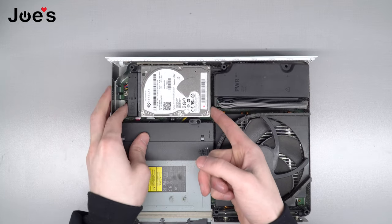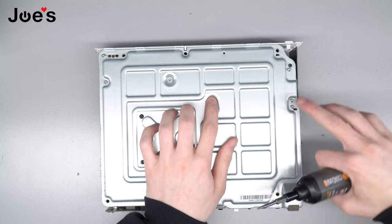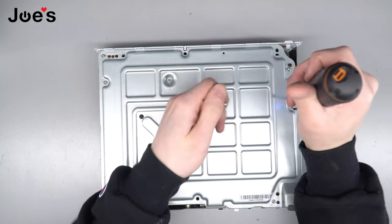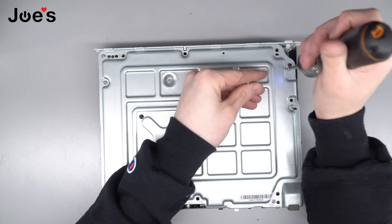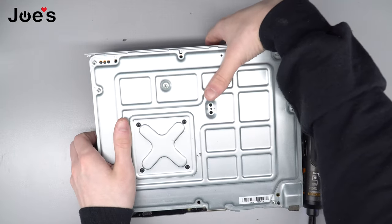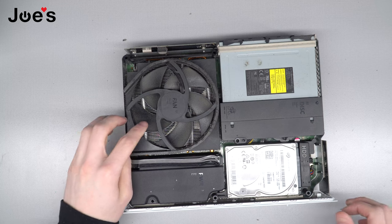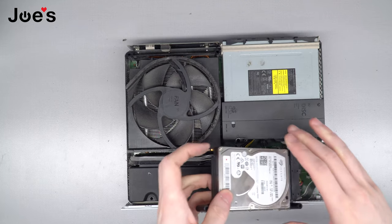It's on this little caddy thing. You'll be like, how come you can't get it out? You've got screws here on the backside. Put those aside. Now when you flip it over it's gonna be loose, so I kind of try to grab it underneath so it doesn't fly everywhere. This guy is dusty. If you ever open up your Xbox, just get a can of air and a microfiber and just clean this stuff off. I promise it actually will help performance quite a bit.